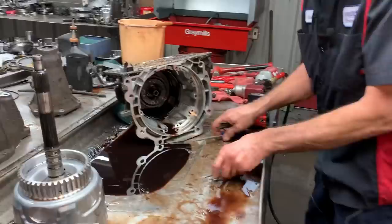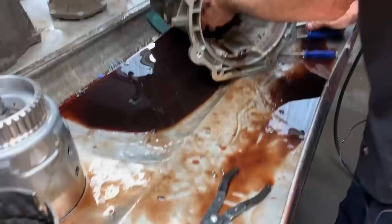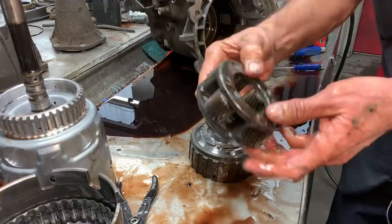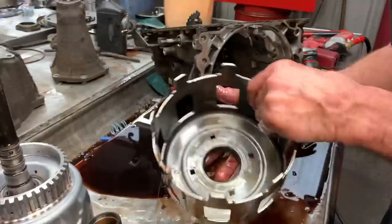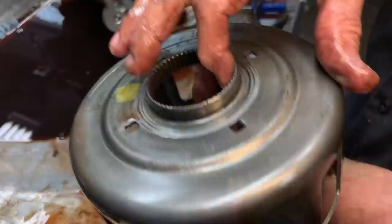Get our band anchor out of there. He's got a standard input and thrust washer up here — we'll be changing that out. We'll be changing this whole hub right here and putting a roller bearing, which he brought to us along with his five pinion planet. The shell is starting to strip a little bit. It is crazy how they have that rub there and they don't take it out — metal against metal. It's really just a thin plastic-type washer so there's really not much load on it, but they make a brass one too.